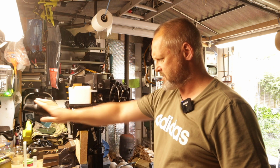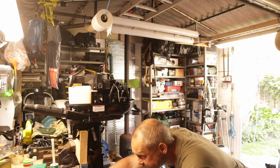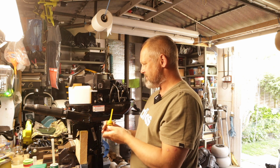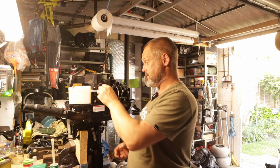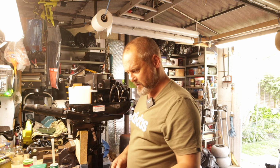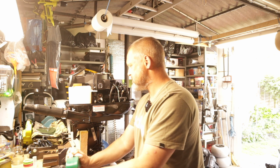We've just pulled it over a couple of times, got all the oil around, and checked what we've got exactly in there. 1, 2, 3, 4, 5, 6. We've got about 600 ml. So it's also important to read the instruction book, because it says to dip for the oil by placing the dipstick in but not screwing it in. So you just place it in and then check the oil level, and we're right on the bottom line. Right on the bottom line, and we've got 50 ml to go.